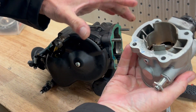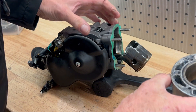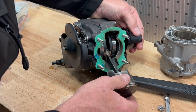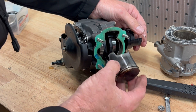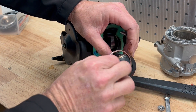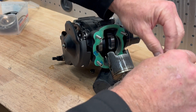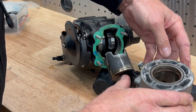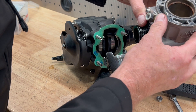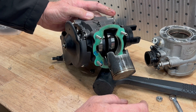The cylinder, other than the corrosion at the top, is in lovely condition. There's some nasty corrosion down inside the cylinder — again, it just hasn't been flushed properly. The things we look at when we're in here: the crankshaft is in lovely condition, good nick. The piston is in not bad condition — not too scored up, which is good. We can pop the piston ring off and inspect it. We'll check the ring end gap in the cylinder. We'll put a new piston ring in anyway since it'll have a new cylinder, but the rest is in quite good condition.